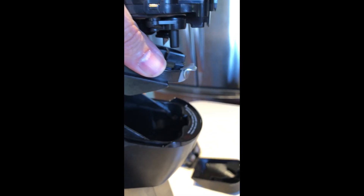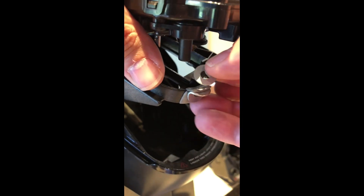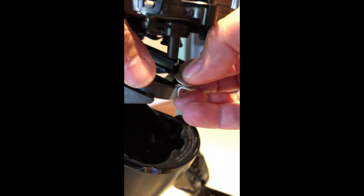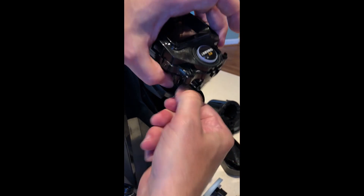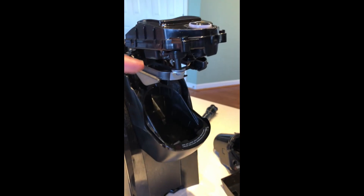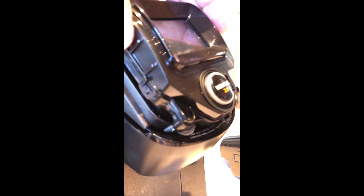So now you have the half-bent washer stuck to the side, and I'm going to take the other flat half-inch washer and stick it not right on the outside edge but angled in a little bit. What happens now is when the lid comes up it won't let it go up and get stuck — it stops it. When it goes down you'll see it fits right in there and doesn't get in the way.